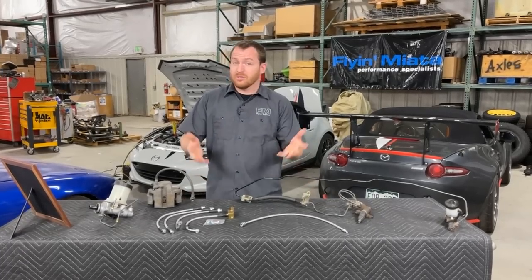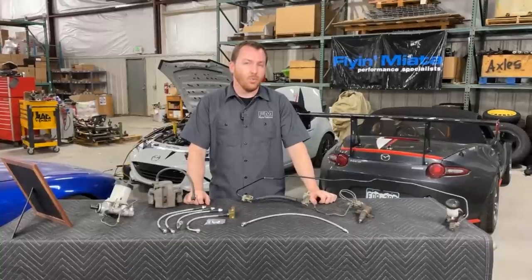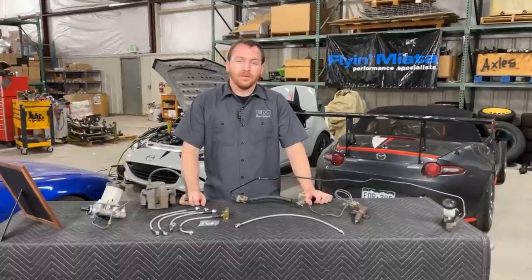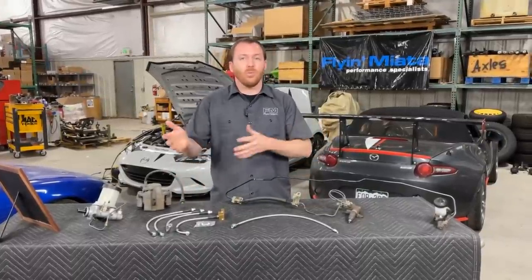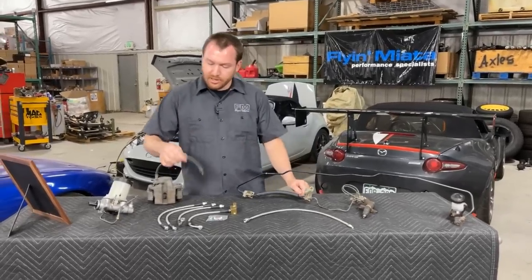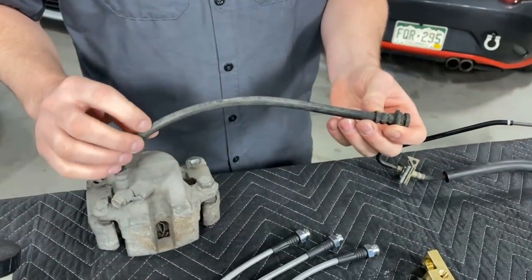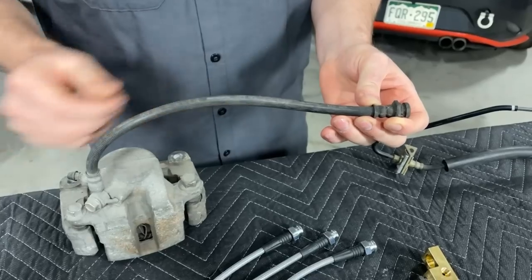So it's a hose — a fancy hose, in short. Now, why might you want a stainless steel braided hose for a clutch or brake line application? The big difference we should probably start off with is that for most brake lines and clutch lines, they are rubber — and you can see they're DOT labeled and all that kind of fun stuff.